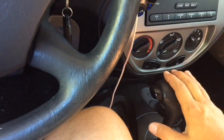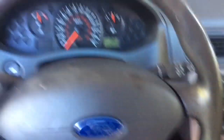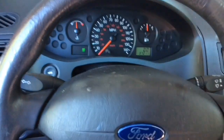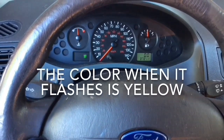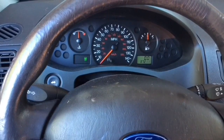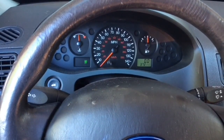Now that was not my son's problem though. He didn't hit this switch — you can sometimes accidentally hit it, but he didn't, he's aware of that. He was just driving, his hand wasn't anywhere close to this, and this light came on but it was flashing. If it's flashing it means there is a problem with the transmission. It went away and stopped flashing and returned to normal, so it's intermittent.